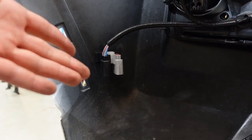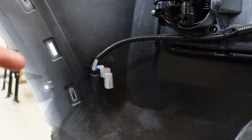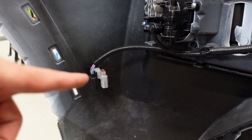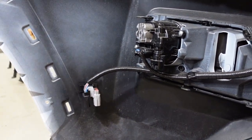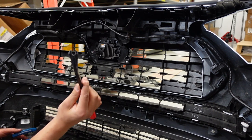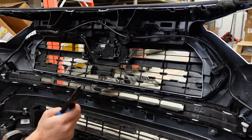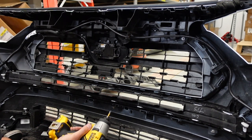Inside the bumper, the main clips over here on the driver's side — make sure before you completely remove the bumper, you undo these clips, which connect to all the sensors, fog lights, and everything on the grill. Make sure that's unplugged — it's the only plug — so that the bumper can be fully removed. To remove the current grill, use a cat claw or small pry bar, wire strippers or needle nose, and a standard Phillips screwdriver.